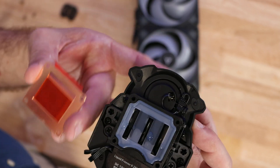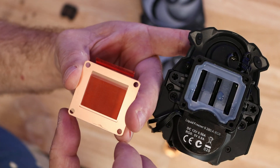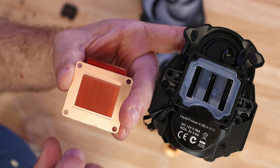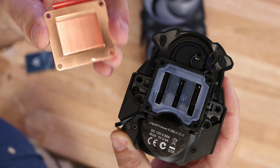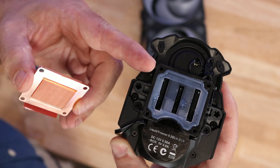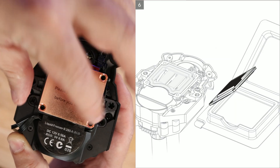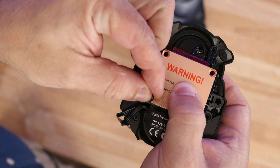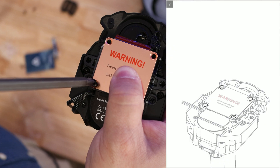You'll notice right over here there is a larger gap between the fins and the copper at the top than at the bottom — there is a bigger gap up here. That means you install it just like this; you don't install it the other way. That gap needs to be towards the top, away from the text. Just drop it in like this, push down to make sure it is sealed properly, and place those two new screws at the very bottom — remember they are a little bit longer than before.